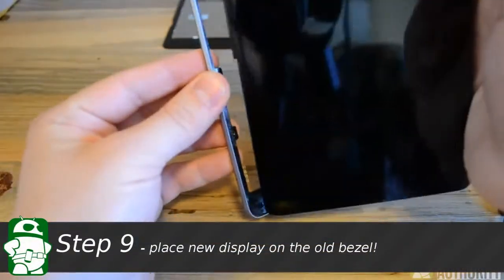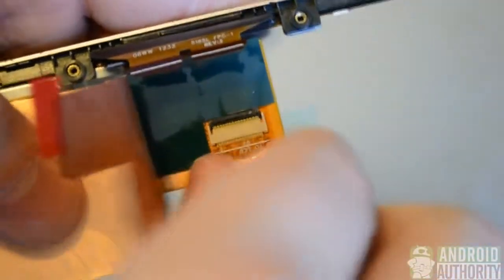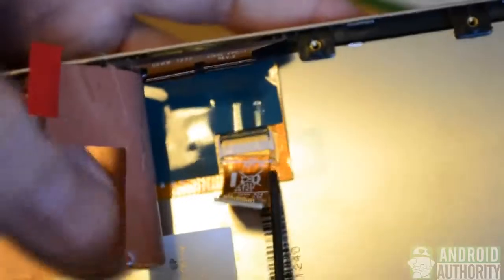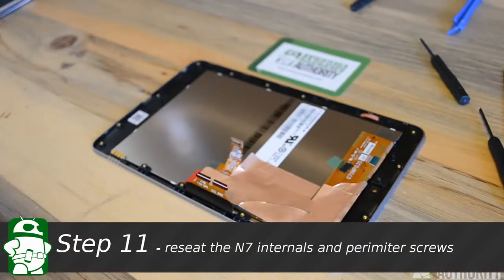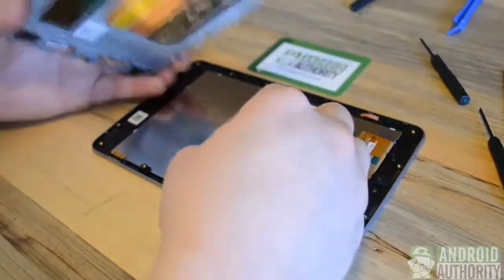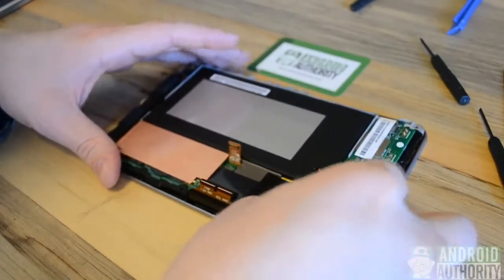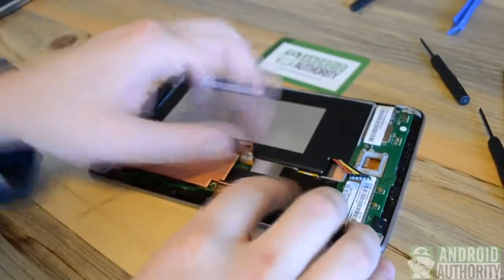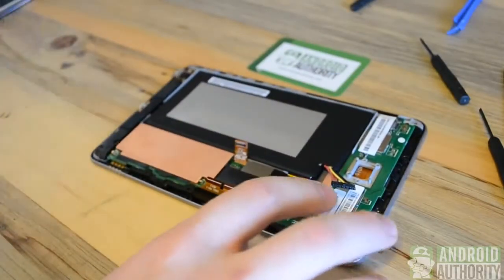After that we're simply going to line up the new display and insert it into the bezel. Next we're going to reseat our LCD connector ribbon — we'll put that back into its connector and use a small tool to shimmy it in from the left and the right. We can also use some of the original copper heat shield from the display that we removed. We'll then take the rest of our Nexus 7 body including the motherboard and reseat it to the new display, lining up the LCD connector cable so it comes out on top. We'll make sure we have a tight fit and it's seated properly, then put the screws back in the perimeter of the device.